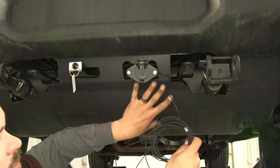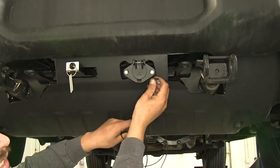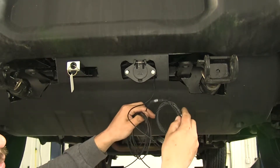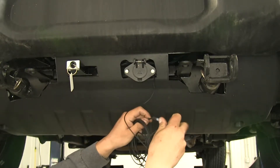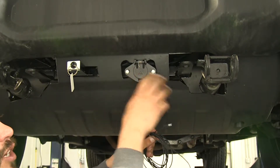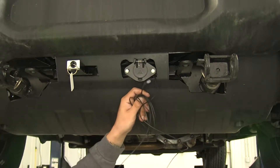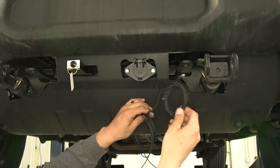We can tie up the excess behind our skid plate so you only have a little bit of that connector sticking out, and then you would take the patch cord and plug it into the connector with the other end going into the motorhome side. However, we're going to wire ours directly into our six-way connector so it's a little bit more permanent and we don't have to worry about moisture, corrosion, or losing our patch cord.